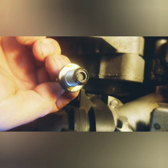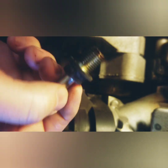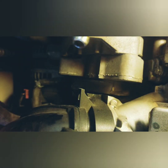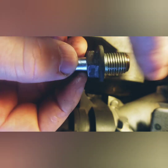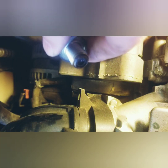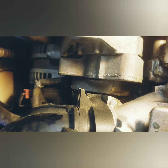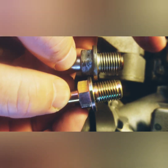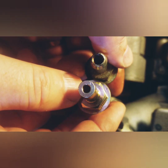There's the old one — you can see the oil, and that is caused by the fuel and oil combined. You can shake it and you can hear a little bit of the check valve in there. It has a check valve so nothing goes back down this way, and all the gases and fumes go up and out. We'll take it over and compare it to the new one. I suggest on any parts, take the new one and the old one and do a comparison — you can see they're pretty much identical. Looks like the aftermarket O'Reilly one has a slightly smaller diameter.